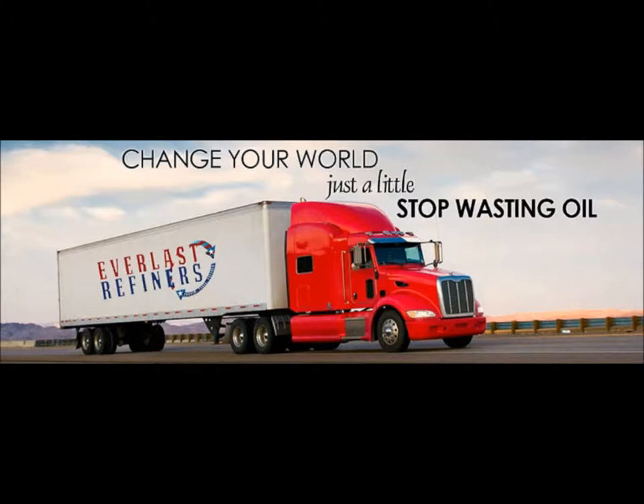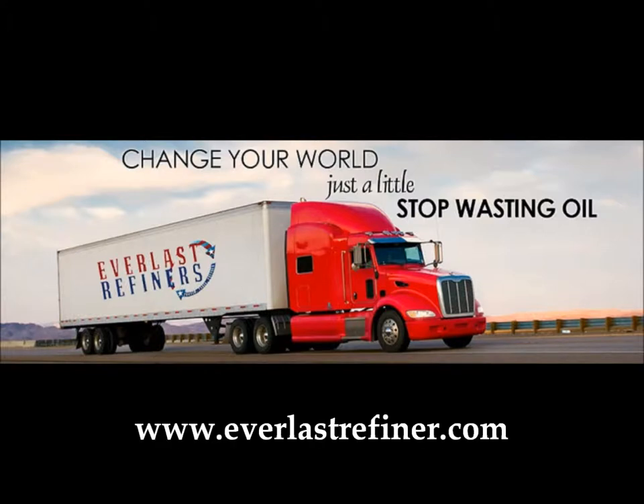So there you have it. Bypass oil filtration reduces particulate contamination in motor oil from above 30 microns to below 2 microns with a very fine filter. It removes water contamination and fuel contamination, which controls oxidation and fuel dilution. These examples of bearing wear and bearing damage are all preventable by use of bypass oil filtration. I hope you enjoyed this video — please be looking for more videos in the future.